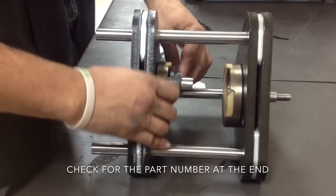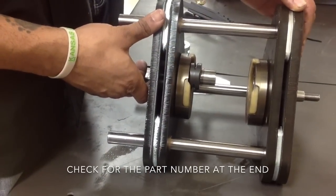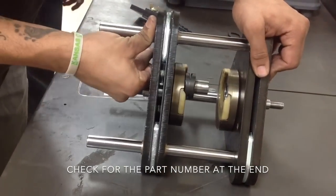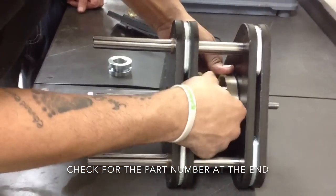Okay, so the pin has been pressed into one crank web, and guys, I don't want to hide anything from you. That is the old rod and the old pin. We're putting it back together. This is practice for us. So it's going to slide the two halves of the jig together and then line up the holes for each crank web for that bottom end big pin.